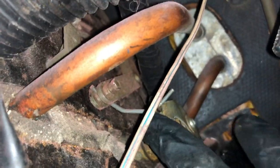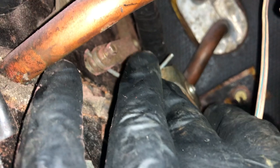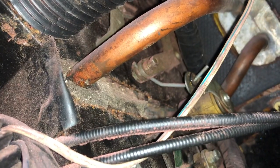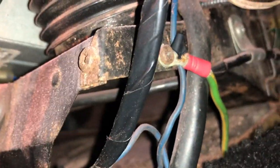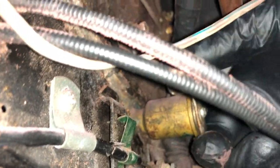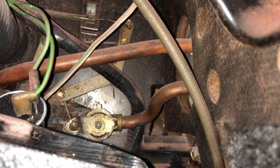And there it is, you can see here, it's controlled by a push rod and a Bowden cable that's attached to that lever I just showed you earlier on the fascia. And that should turn in its brass housing away from you and towards you. And clearly, looking at a couple of the other levers on the fascia dashboard, you can see they all work. This one, however, isn't and appears to be stuck. I think it's quite a common problem that these get corroded inside and stuck.